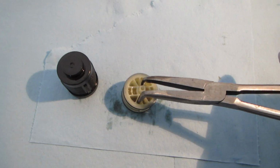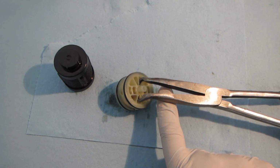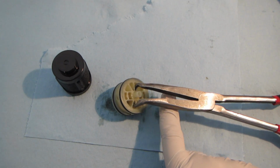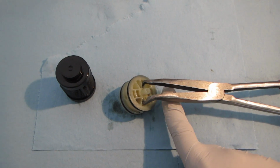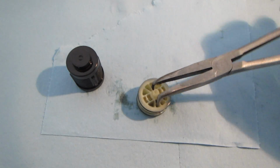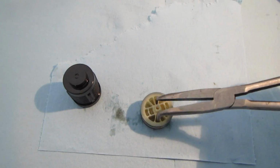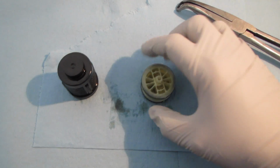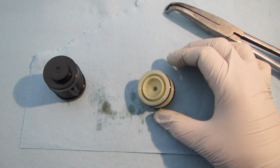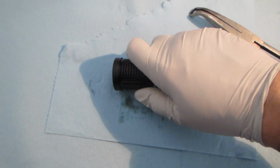So you can grab it, and then you can use something else to pry against either the body of the Haldex unit or the exhaust bracket that goes right by, and you can actually use that to pull it. And also you can twist. This twisting motion helps to loosen it, and you can twist and pull, rock side to side, and then it will come out. I noticed it was still pretty stuck when I was pulling it out, but it came out fairly easily. And it came out, first it was the white piece, and then it was the black filter itself.